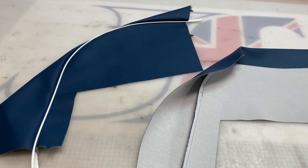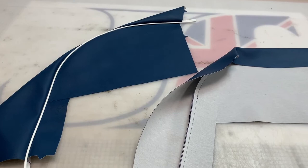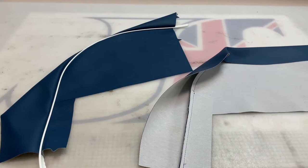These are the wheel arch covers for the Triumph TR3A and TR3B models. They're only applicable to the late version TR3As and then all the TR3Bs. The late version TR3As are the post TS60000 on the chassis number range.